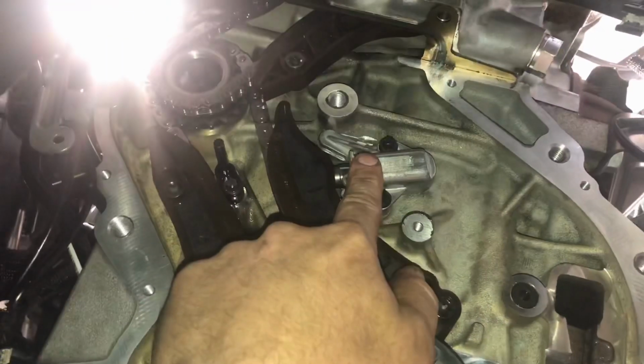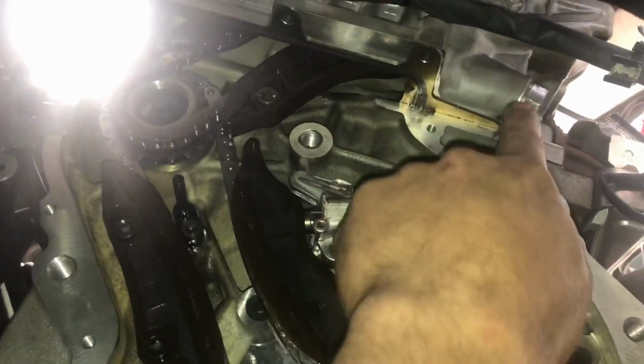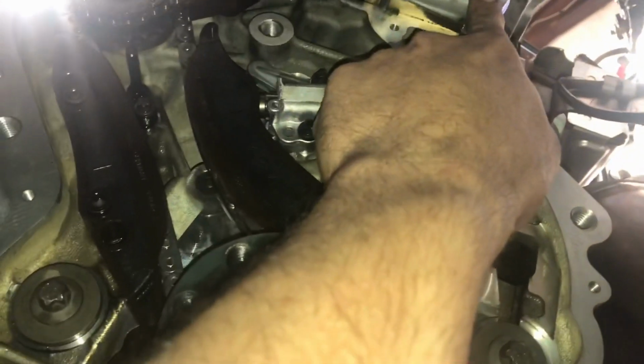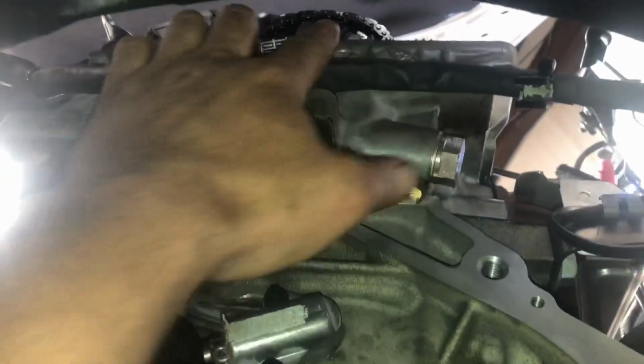Right, okay, so everything's on, tensioners are on, pins pulled, sorry. So you pull this one, which puts the tension on, and then winding your upper tensioner, 70 newton meters, I think that one. And then obviously everything's locked off and ready to go. Double check everything, you know, these need to be tightened down to the bolt, 65s, 70s, 10s, it's critical. So they're all done. Up the top, locked off the camshaft bolts, and then rotated engine. Obviously, it's this way, anti-clockwise from the back, but from the front, clockwise.